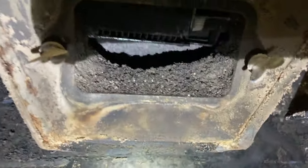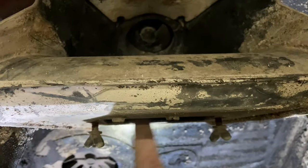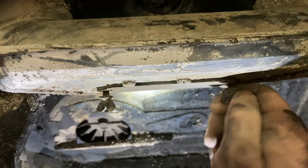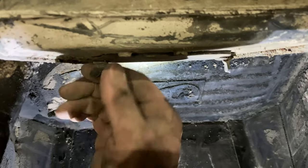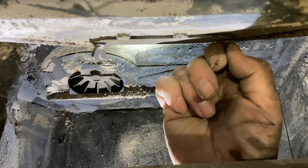I got that space all cleaned out in there, so now I can put the plate back on. You can see my hands got pretty dirty doing that because you have to stick your hand in there carefully — there are wires in there with the igniter. You always want to do all of this cleaning when the stove is cool and not hot. You don't want to over-tighten those butterfly knobs because they get really hard to come off if over-tightened.